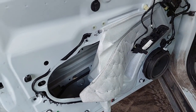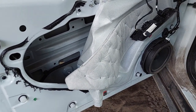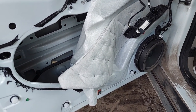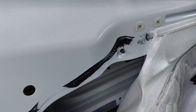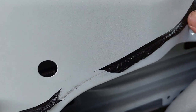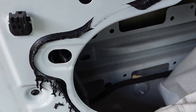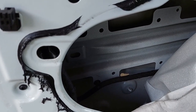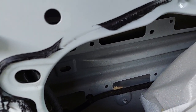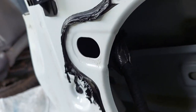I have peeled back the barrier — this is a combination of NVH noise vibration harshness and weather sealing. Don't worry about this black goop right here, it's real tacky and you can press your seal back on it. I'm going to throw a little heat on it as well to make sure it gets a bit gooey after all is said and done. We now have access to the latch mechanism.